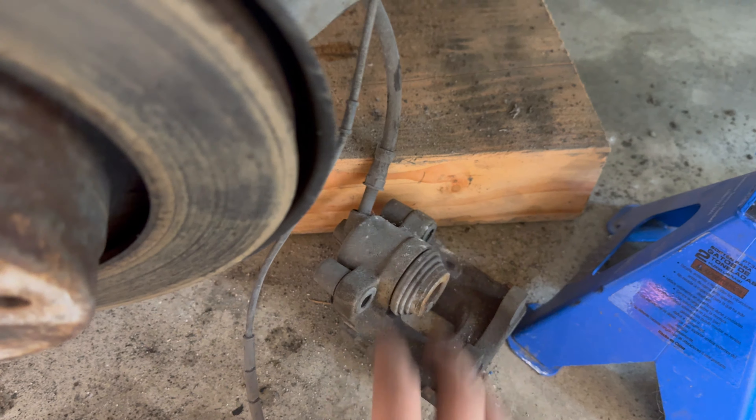I completely forgot to film, but here is the subframe pulled. It ended up being the four subframe mounts that you can see in this picture, and then there were another four 13-millimeter bolts right under where the axle mounts. The subframe did fight us a little bit but basically we just wiggled it around and slowly let the jack down. It helped a lot having three people, so I'd recommend having at least two. You could probably get it by yourself but it's going to be a real big pain.